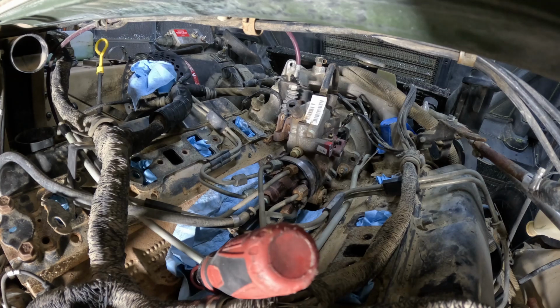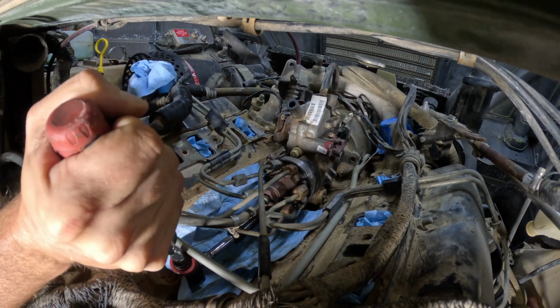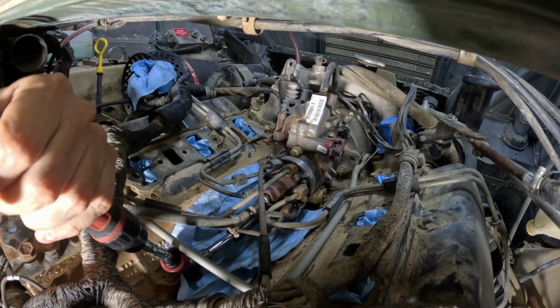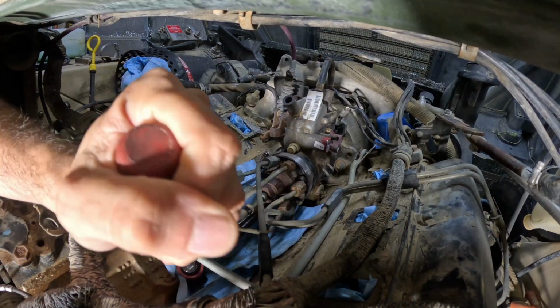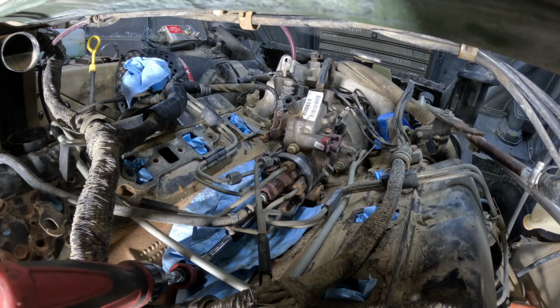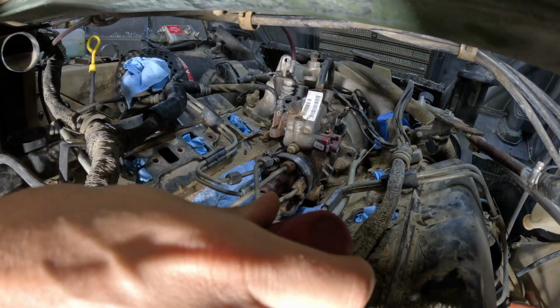So for removing the bottom injection lines, I have a special wrench that is a socket with a slot cut in it to be able to slide over the line and get to the fitting. So the tough part is going to be how rusty these things are. Some of these are pretty stuck. So I have 2 left, and this bottom one seems in there pretty darn tight. So I'm actually worried about stretching open the socket at this point.